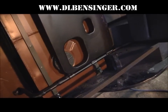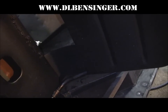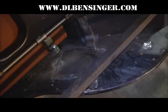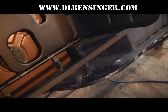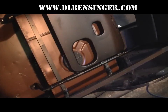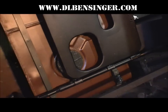This customer had moved this seat frame back. As you can see here, he moved the seat frame back to get more room. That was fine when he had the CJ2A tank in it. You can see where we welded up the side of the body where the CJ2A tank was in. Now that we're putting the correct MB floor in it and the correct MB fuel tank, now we've got an issue here with the fuel filler not going to fit where the seat goes. That's not going to be a real big deal.